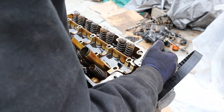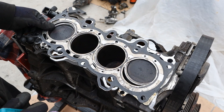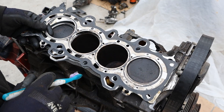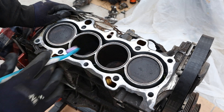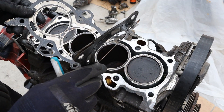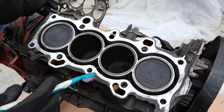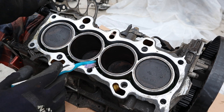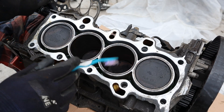Now I should be able to lift the head off. And here we come to one of the biggest failures on this engine — that's the head gasket. These are really known to fail on these engines, and that's going to cause them to overheat. When they overheat, the block or the head itself could actually become warped and then you lose compression. The gaskets on these are a multi-layer steel gasket — this one looks like it's probably the original at 192,000 kilometers. One telltale sign that your head gasket is leaking is the coolant starts to disappear in the coolant jug on the radiator, because the coolant is not sealed between here and the combustion chamber and it's actually burning coolant in there.